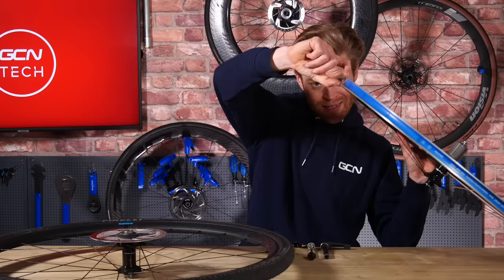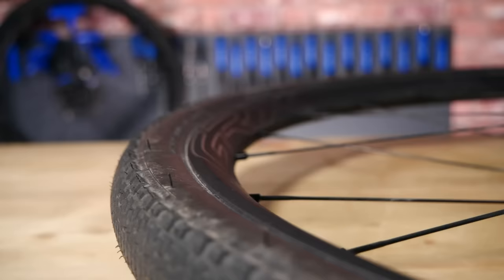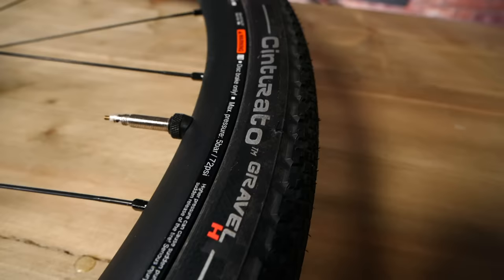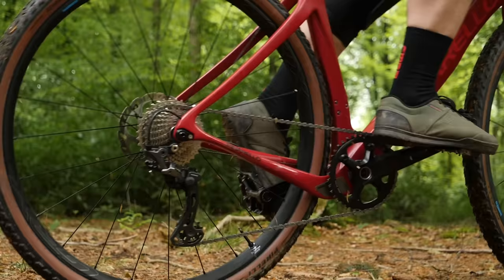Rim width. Over the last few years, wheels have been getting wider and wider, following the trend for wider tires. Ten years ago, 14 millimeters internal width was the standard that came with most wheels, whereas today it's typically around 19 millimeters internal width, which is ideal for 25 millimeter tires so that they can sit nice and flush and have a nice big contact patch. However, wheels get even wider now — you can also get wheels with 22 or 23 millimeters internal width, which is ideal for bigger tires such as 28 millimeters and above, giving you added flexibility if you want to ride both on the road and fit some gravel tires and take it off-road.